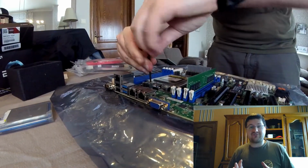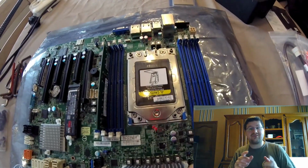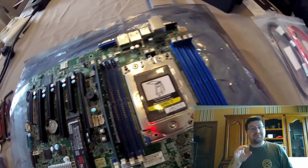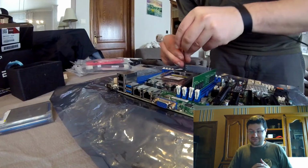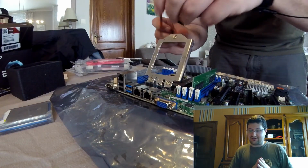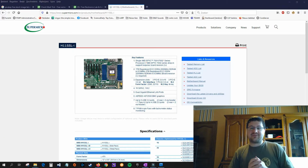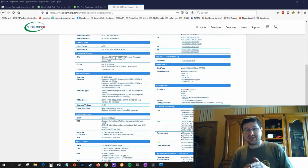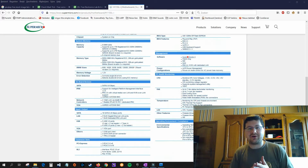It's pretty fast. Now, this CPU has an SP3 socket, which is the form factor of the CPU that has to go on a motherboard. That's important to know, because then I had to look for a motherboard that had that kind of socket. I eventually came upon a Supermicro, I believe it's the H11SSL-I. I did notice that the processor I chose was one of the latest revisions. At the time when I picked it, it was literally just coming onto the market. So it was brand new.